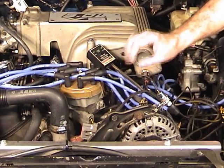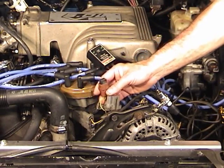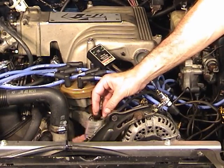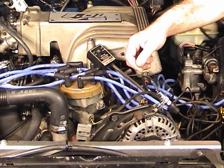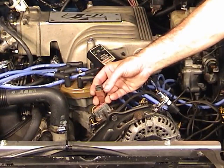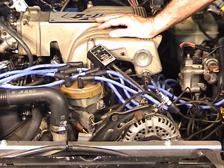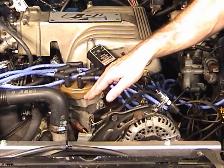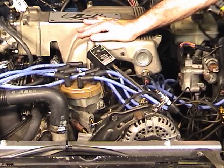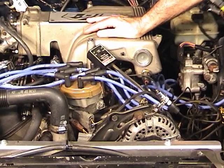If that checks out okay, there is one other thing that you could have going on, and that is the spout wire might be shorted. What you would want to do is plug it all back together, have your dummy spark plug back in, and take your spout shorting bar off. Pull that little shorting bar off, or on the older model ones it's actually 2 wires, you have to unplug it, and then see if the engine starts or see if you have a spark. If you do, and you can get the engine started and you plug that back in and suddenly the engine cuts off or starts running super ragged, there's a chance there is a short in that wire, or there may actually be something wrong with the PCM. It may come down to replacing the PCM if you determine that that wire is not shorted.